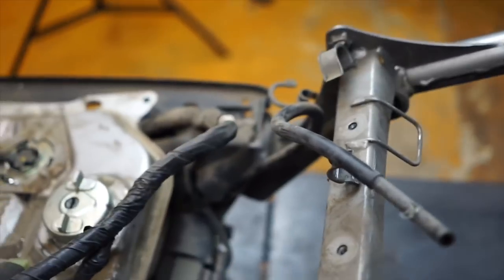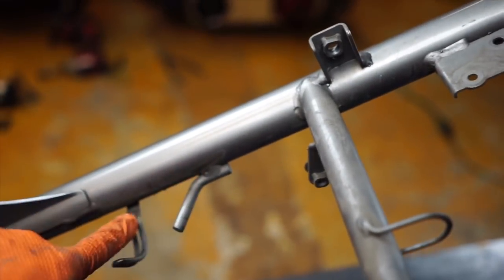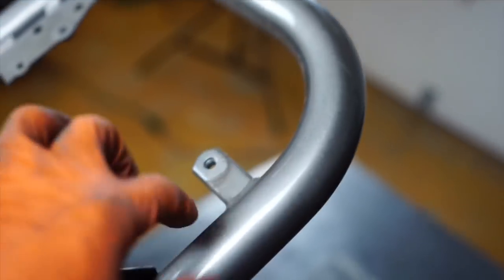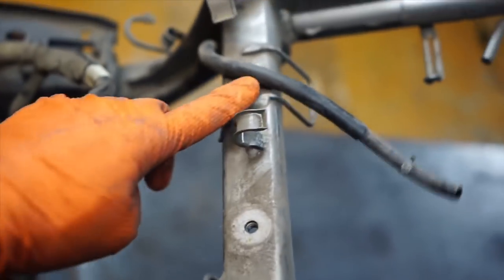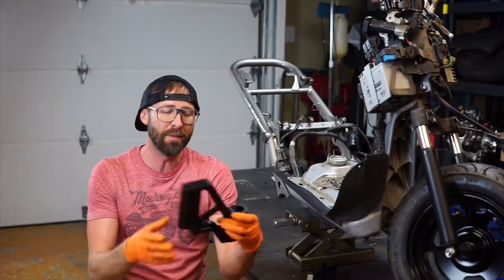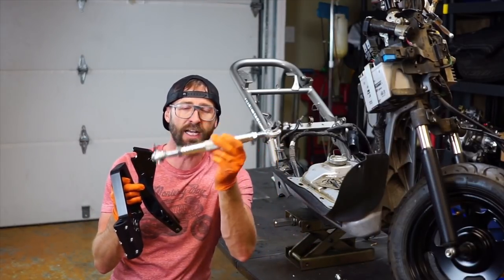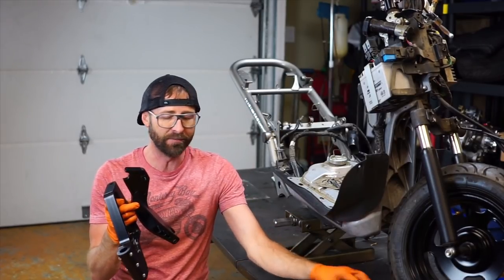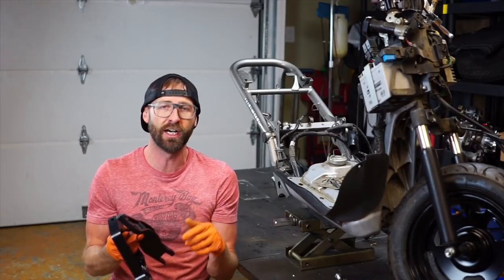Our harness we're going to use — we're not removing any of this original harness. We're going to use the original fuel pump, the original throttle cable, and then we've got our rear brake cable that we installed. At this point you can remove all kinds of stuff if you want to. Most mounts you have to grind this off and all this stuff because there's a plate that runs right here, but not this JDM mount that we're using. The JDM mount is sweet — it's all billet, anodized black, comes with about three bolts and this adjustable tie rod type linkage. Requires very minimal grinding, unlike most mounts on the market. I'm going to show you exactly what you need to grind off to make this mount work perfect.